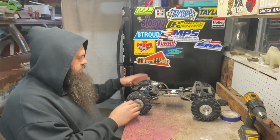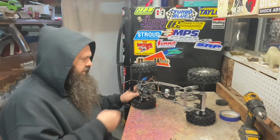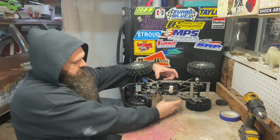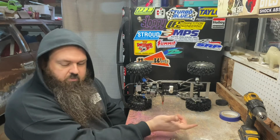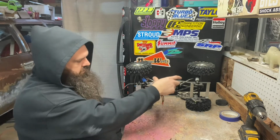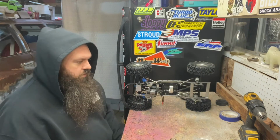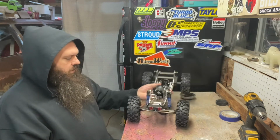For the rolling chassis with the transmission and the transfer case and everything, like I said, it does have huge tires, but I think even with a little smaller tire, that's a pretty good side-to-side center of gravity. You still have the batteries, and the batteries are gonna be nice and low, kind of down here on the sliders. So the only thing is I'm gonna try and build the brake line. I have plenty of solid rod. I just don't really feel like filling the whole back of this thing up with solid rod, even though it's only gonna be probably one hoop, a crossbar, diagonal, a couple bed bars. That's still a lot. And with the weight savings of brake line over that, that's gonna be a decent amount. That's my plan.